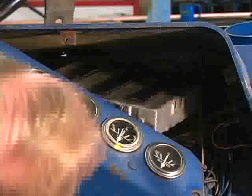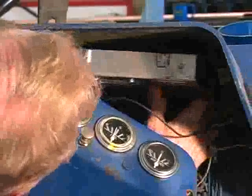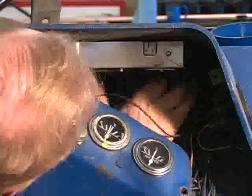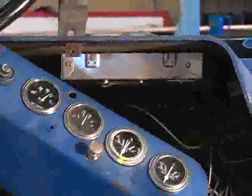Notice how the harness is not pushed all the way through. To install the ECM, remove the front part of the dash. To make installation easier, adhesive strips should be already placed on the ECM. Go ahead and place it underneath the top part of the dash. After the ECM is placed, go ahead and attach the wiring harness to it, matching the corresponding connectors.